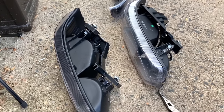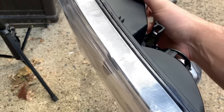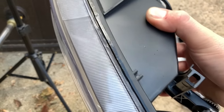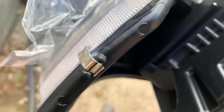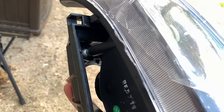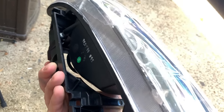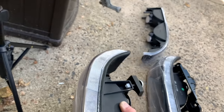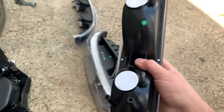I'm sitting here siliconing away. I got one headlight done. All I did was run a bead of silicone all along the seam around the light, put a good glob underneath the clip to make sure that's sealed up, and the same thing on the bottom. You can see the factory silicone coming out in one spot — that was the only place I could actually see the seam. I went around the entire thing filling that gap in, then ran my finger across it to make it smooth.